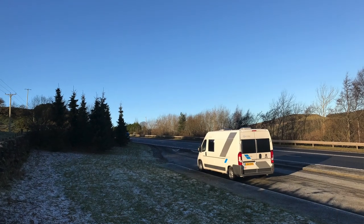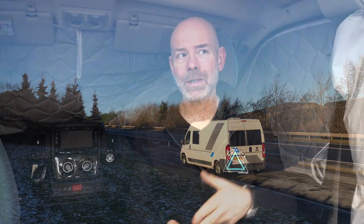I think it's no secret to anyone who's been following this trip that I really wish we had had a second battery fitted. The Sun Living van came with the option of a second battery and the wiring — I didn't take up that option. That was a huge mistake. If you're planning on spending any nights off the grid, even one night off the grid, you really do need that second battery because of the consumption of the compressor fridge, the fan heater, and so on.